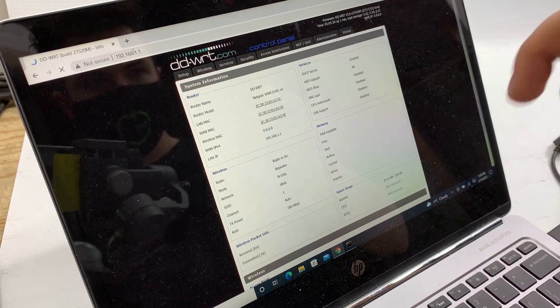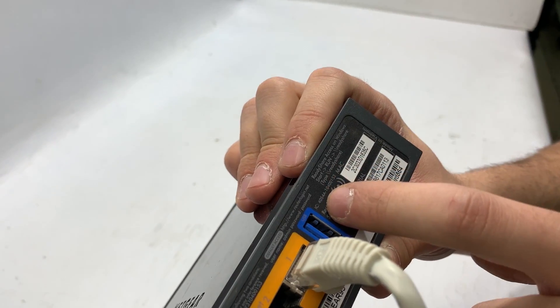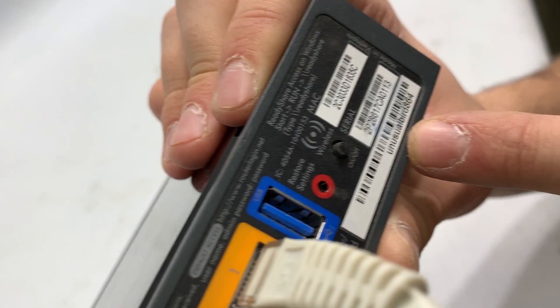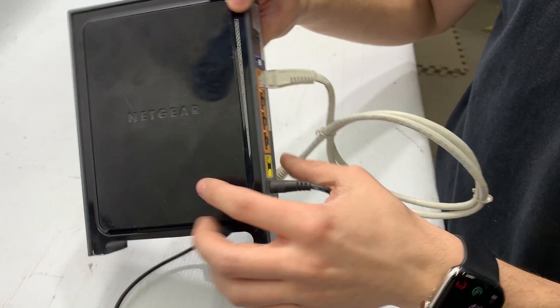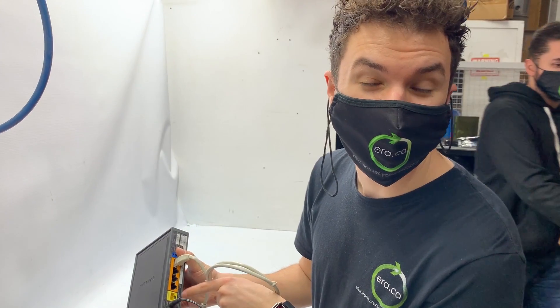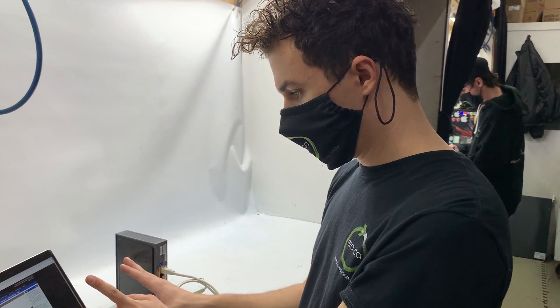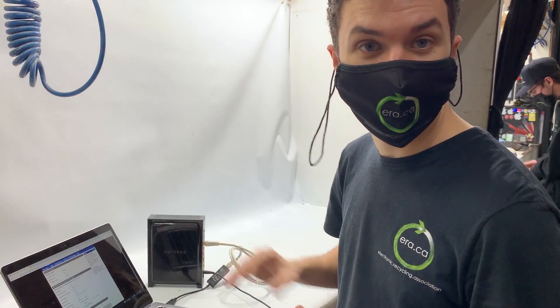Now I have my wireless router interface and I'm gonna turn this one into a repeater. On your router, when you sign into the administrator webpage, it will tell you the username and password. I took the sticker off my router, but it should be there. Otherwise you have to Google your router model number and find the default username and password. Every router is gonna have a different interface, but it's gonna be in the same ballpark. What I'm doing here will be similar on other routers like D-Link, Dell, NetGear — not exact, but close to the same configuration.